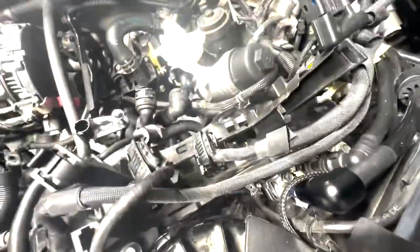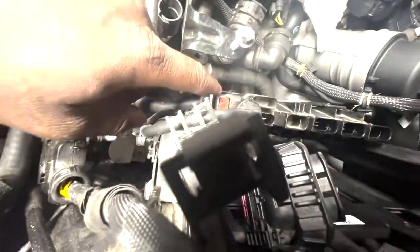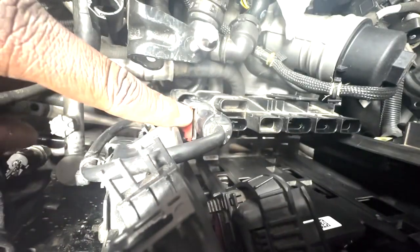The two most unique ones are these two end ones, and this will sit just like this inside of that holder. Right, coming over here, just make sure all the DME lines are out of the way. And again, this only goes one way with this piece pointing forward, lining up with this connector. So we're just gonna put this in here. All right, so first connector to go in is this. Just gonna push down this locking tab like that, and then that's properly secured in.